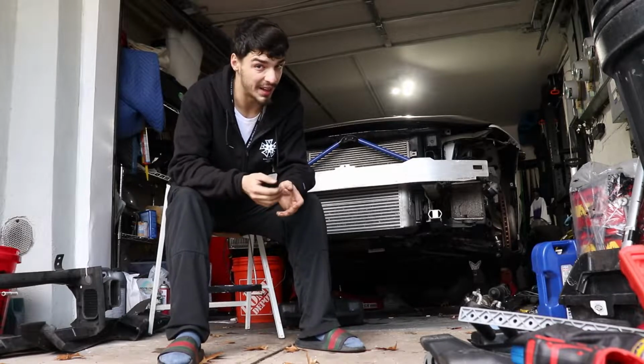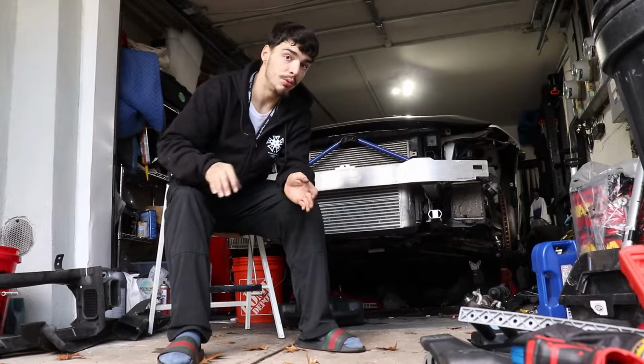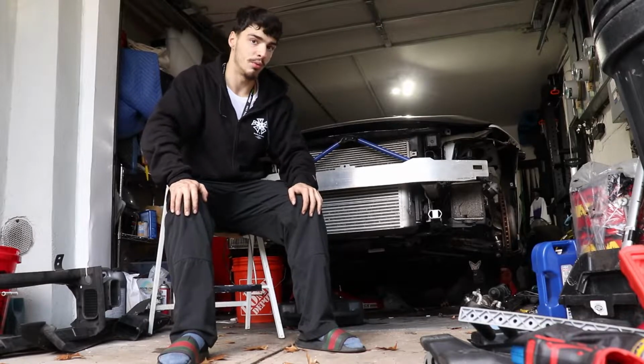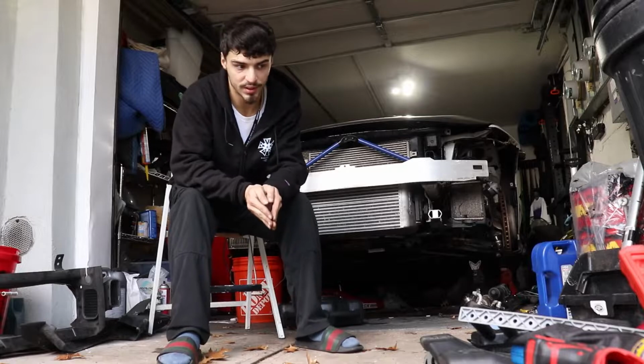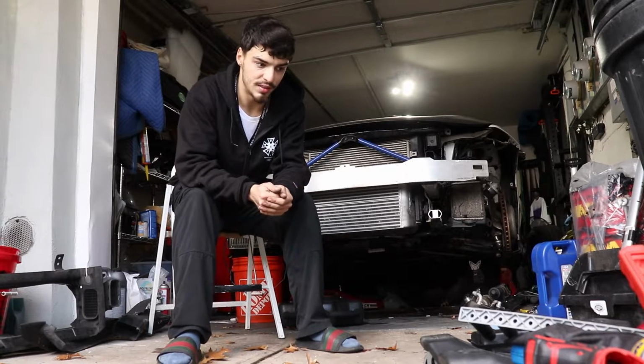We've got a rough idle. I can't target rod knock. I'm thinking it's turbo seals. But if we do turbos, we need to do the motor, and this motor has 101,000 miles, so the last thing we want to do is throw on a big boost turbo, start pumping insane amounts of boost, and then break the thing. So we're potentially facing some motor failures.